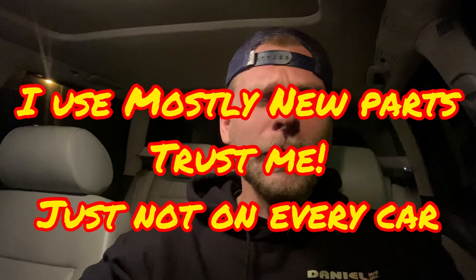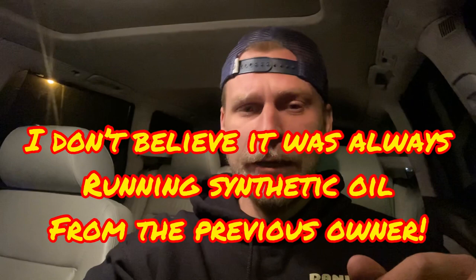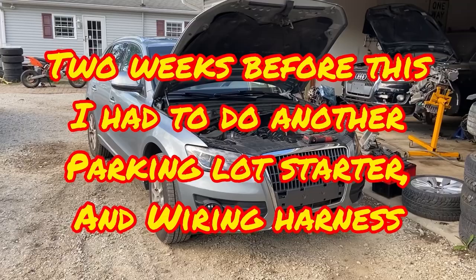The reason why the timing situation was out of hand is because there's a high mileage engine with some sludge going around. Watch my other videos — I just recently threw an oil pump in it. It's a really super high mile engine, and I'm helping a friend out. I put a much lower mile oil pump in it so I feel a lot better about it. I needed to clean out the oil pan with the sludge in it anyway. The oil pressure sensor was clogged up with sludge, as well as the cam bridge and the VVT system, so I went ahead and blew and cleaned all that out.